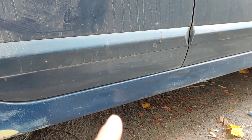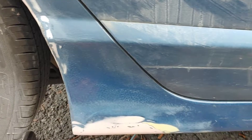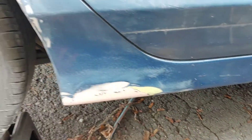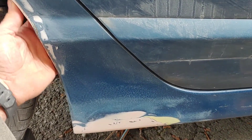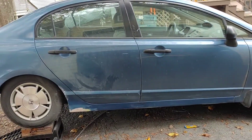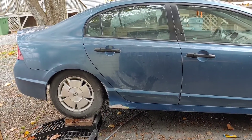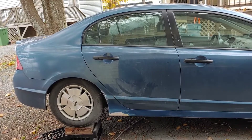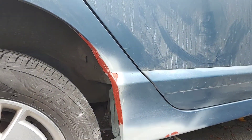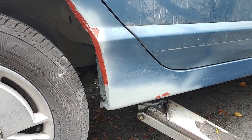The rockers are not great - they've been repaired in the past. I patched up the two holes and also did this additional spot - just patched up what was identified during the vehicle inspection. The problem is it's freezing cold, only three degrees above freezing - not ideal. I've got no room in my garage because my Comet's in here. This is the turd civic and we're only doing whatever we can to get it road legal. Got the area primed, came back with a little bit of glazing putty to go over the imperfections.